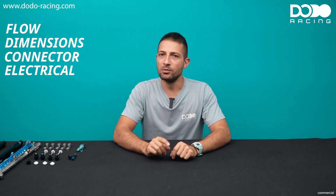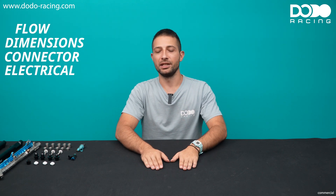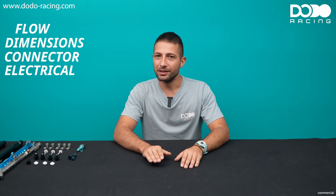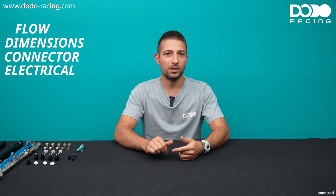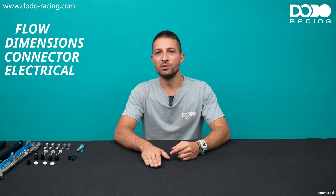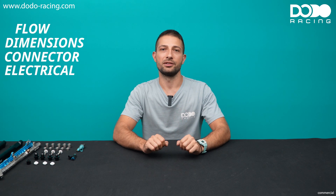The first thing you are most probably looking for is the flow. But please don't make the common mistake and buy too large of injectors. They won't make your car run any better - in fact they will make it run worse. You can just go to our website, we have a calculator, you can put in your target horsepower, your boost pressure, your fuel type and it will give you the minimum flow you need so you can get the right size of injectors.